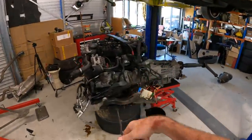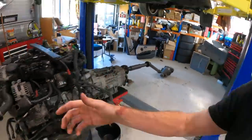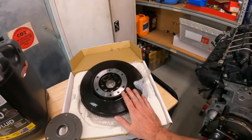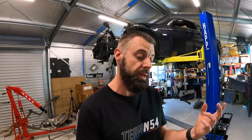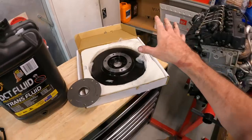I could have used this engine, but because this DCT has about 190,000 Ks on it, I really don't know the condition of the dual-mass flywheel, and when I start winding the power up I might run into issues. The downside of single-mass flywheels is they will cause chatter, like a single-mass flywheel in a manual car. I've tried to find videos showing the chatter and to be honest they're not too bad, but I am aware of people who bought these as an upgrade and absolutely hated the noise and went back to the factory flywheel. We'll see how it is — if it makes noise, I might end up buying a genuine dual-mass eight-bolt flywheel.